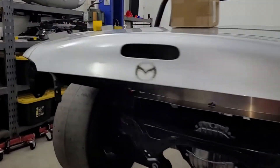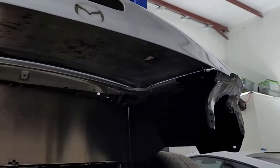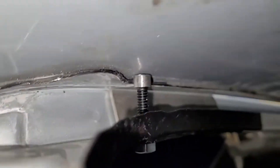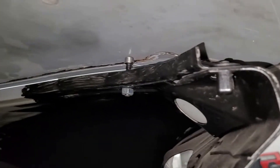That's the backstory - enough rambling. I am not saying this is going to work; everything I've done so far has failed, so this may just be for your amusement. What I did: I drilled some holes here and here, and I've got to do some more up here. I grabbed some bolts - I don't know if I can weld to these but maybe I ground some of the black oxide off - and I put a nut on both sides. You can move the nut up and down, which changes the spacing to move the trunk lid up and down, and I got the four corners pretty close.